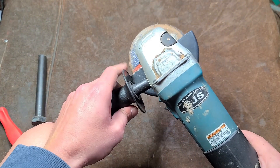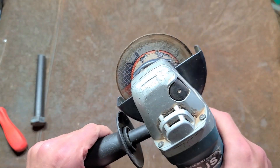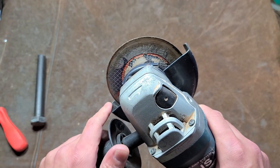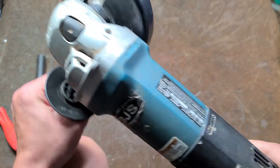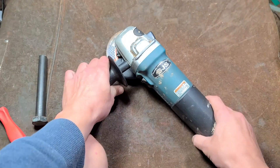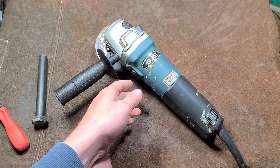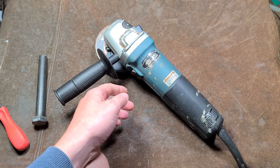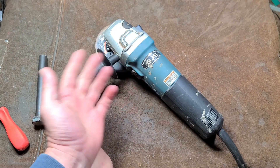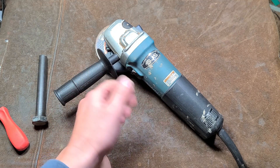It also makes it useful at low speeds with sanding discs. Many times you put flap discs on and they just burn up and clog super fast because they're moving so fast on those 11,000 RPM grinders. On this, knock it down to 4,000 RPM and those flap discs actually last — you get more material removed over the total life of the disc because it isn't just screaming along. Anyway, I really appreciate everybody watching and subscribing. If you haven't subscribed, please do. Until next time, Cadis Maximus out.